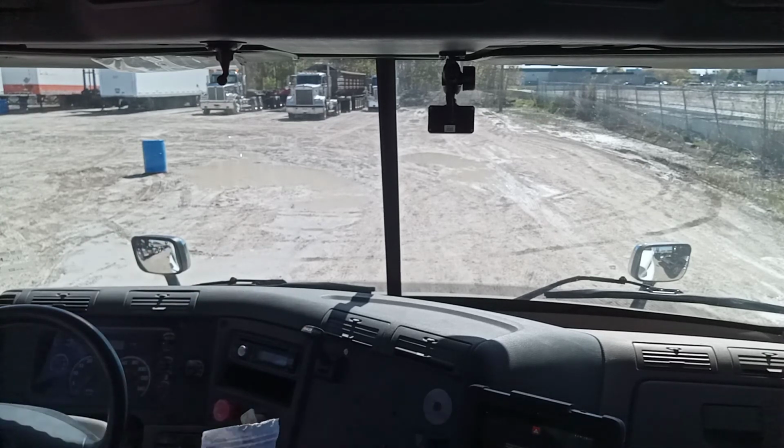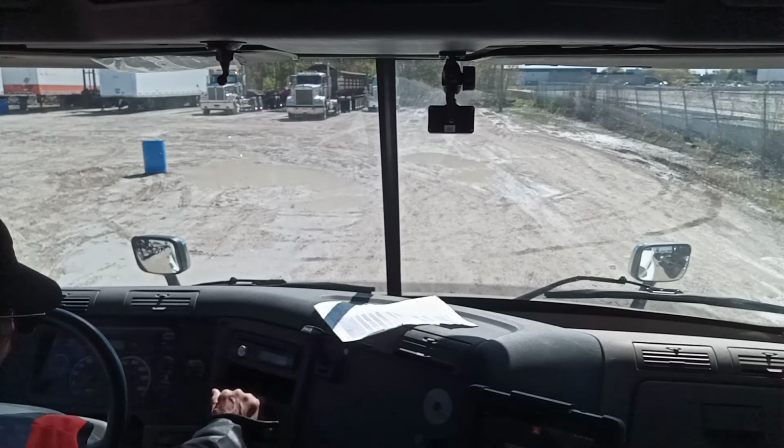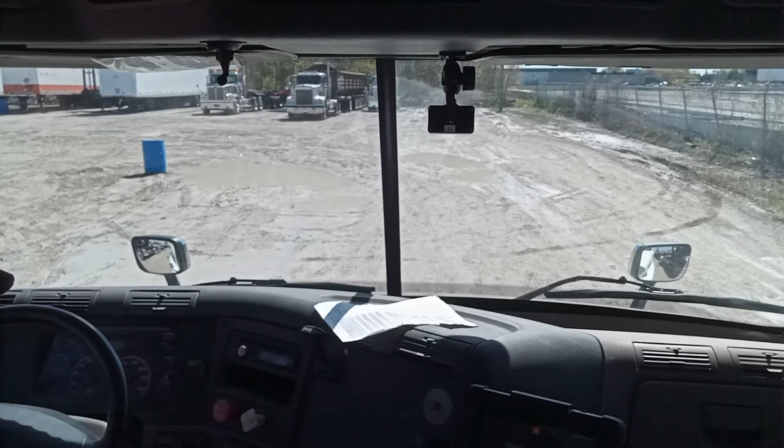Good. Very good. Slow air pressure build-up rate. Okay, we must start the truck, but first you have to fan the air down to below 80. So fan it down to 75. Release your tractor brakes, and then start the truck, because you have a time from 85 to 100. That gives you time to get your stopwatch ready.